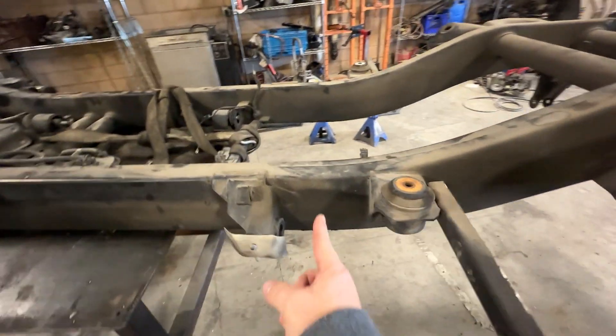These spot welds have all been peeled up. We're going to keep this sheet metal right here, and about six inches underneath is where the frame stops. If we cut this with a flange, it'll be much easier if we cut it completely flat. On the inside, we're going to cut completely flat to right about here, then drop it about two inches and cut it out. The reason is we always like staggered cuts when working with metal — it makes it stronger and doesn't tear in the same area. It gives us a chance to weld from the inside on both sides. This is mostly cosmetic, not structural. We'll put the pillar in, line that up, and add some extra sheet metal.